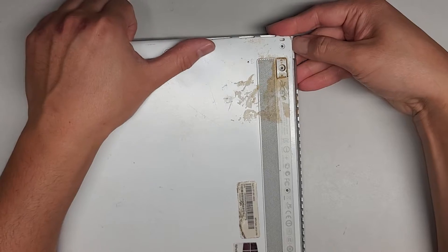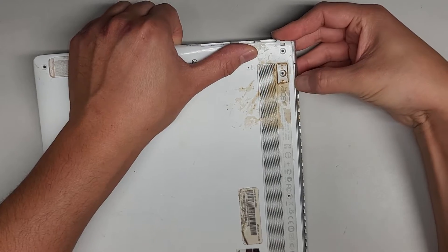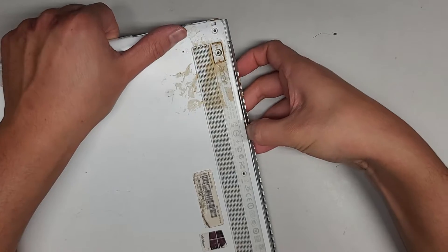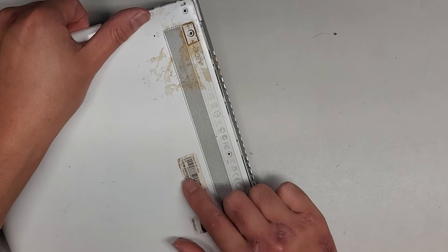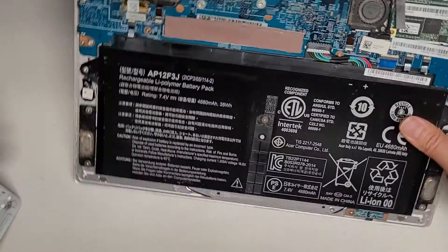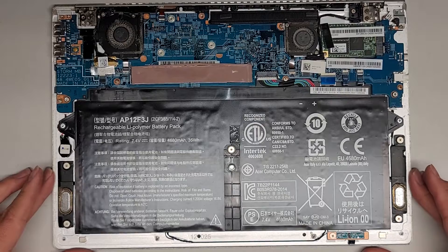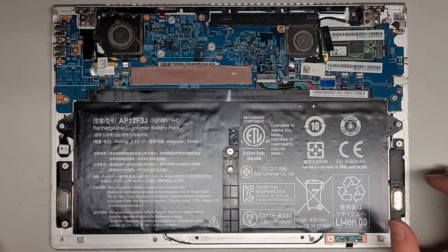It's mostly coming up, but the back doesn't seem to want to move. I'm going to slide my fingernail in here — you can also use plastic pry tools. It doesn't look like there's a hidden screw. We're just going to keep working our way over and there we go — got the bottom cover off. I'm going to try disconnecting the keyboard, and then we're going to attempt to install the OS with the keyboard disconnected, because I have a feeling it might be related to the keyboard.